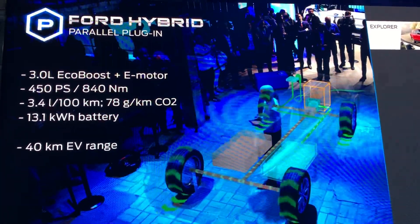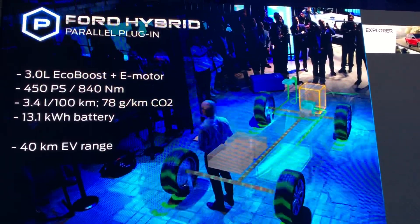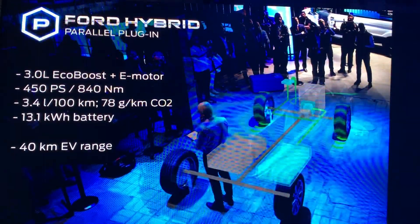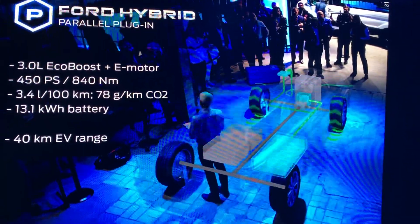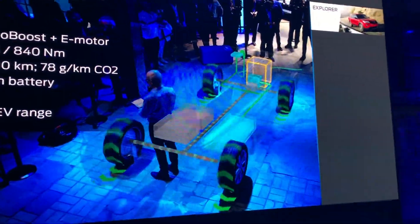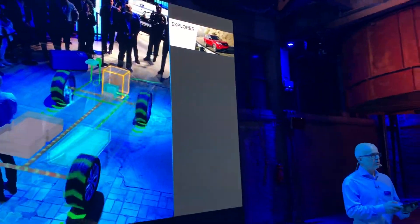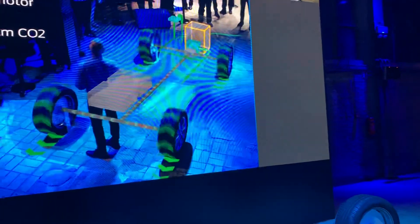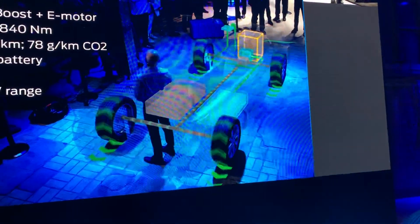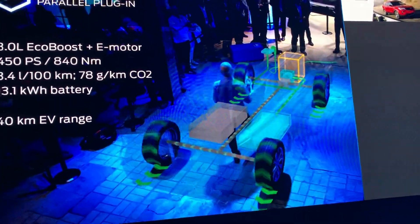You may wonder why we're fitting a power split hybrid to the Kuga but a parallel hybrid to the Explorer. There are two reasons. One is the Explorer's all-wheel drive capability is not compromised in the pursuit of economy. The second is it allows the Explorer SUV to haul anything with ease — from seven passengers, full luggage, full load — and it can tow trailers up to 2,500 kilograms as a hybrid.